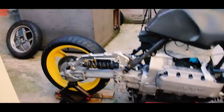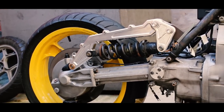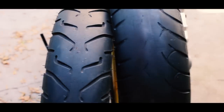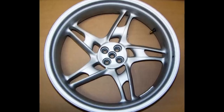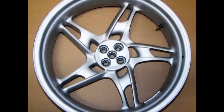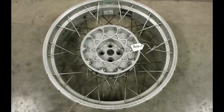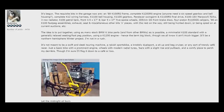You will have to remove your center stand if you want to run a 4.5, or swap it for a four-valve center stand from something like a K1100 if you really need one. When you get your bike, wheel options include the snowflake-style wheel, the three-spoke wheel — noting there are A and B variants with different specifications — the fancy five-spoke star wheel from the K1200, and the wire-spoke wheel from the R1100 GS models, which only requires a little modification and a caliper change. The hard part is just making a front wheel match.